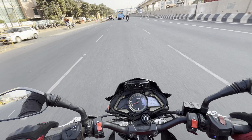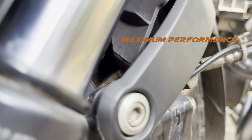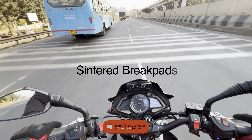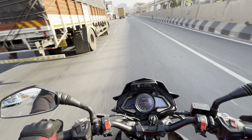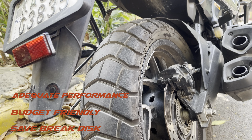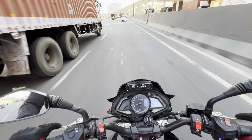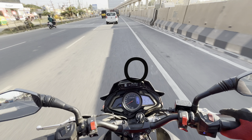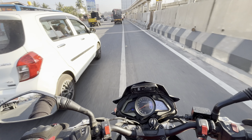Now let's see which brake pad you should buy. If your goal is to extract maximum braking performance, or you ride a race-spec motorcycle, are a heavy track rider, or ride in extreme situations, then sintered brake pads are the go-to choice — no other brake pad can offer this level of performance and stopping power. If you want good performance but don't want to spend much and also want to save your brake rotor, then ceramic brake pads are the go-to. They offer good braking performance while keeping the rotor safe and perform well for day-to-day use. If you are a normal rider who doesn't do harsh braking and wants something easy on the pocket, organic brake pads are your go-to. One important thing to consider: avoid cheaper aftermarket brake pads and buy genuine parts recommended by your manufacturer.